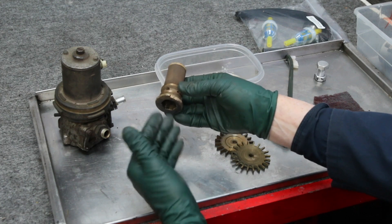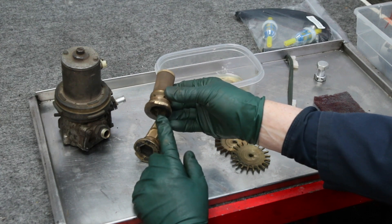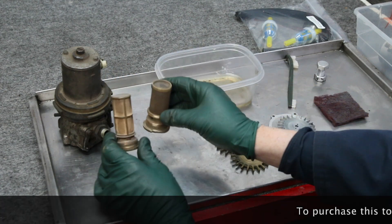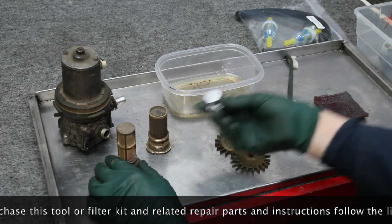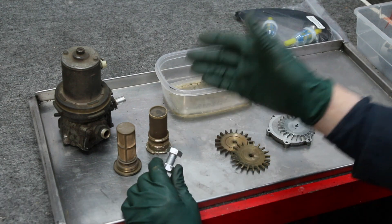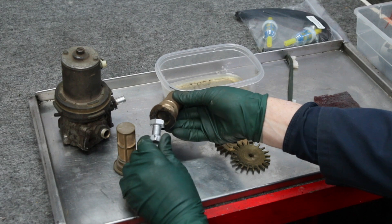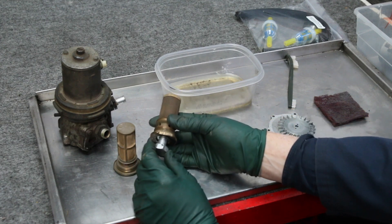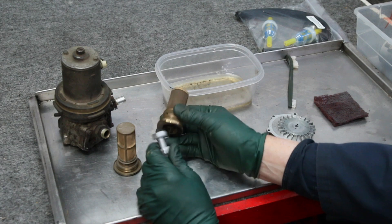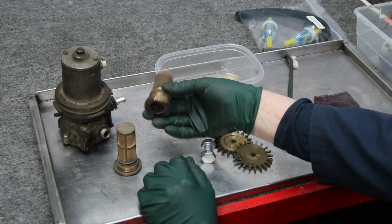These type of screens were used from 1959 right up to 1976 — the W114, W115, and of course all the 111s, 108s and so on have these screens. There is a tool available — we make one right here. If you have one of these old Mercedes and need to get the tank screen out to clean it, this goes right in and you can get a 22mm socket and a breaker bar on it. Sometimes these are really in there, so you don't need to chisel away on the side of your tank screen anymore.